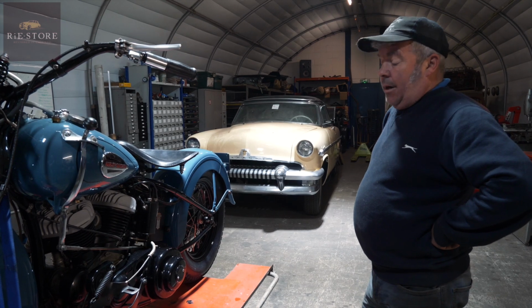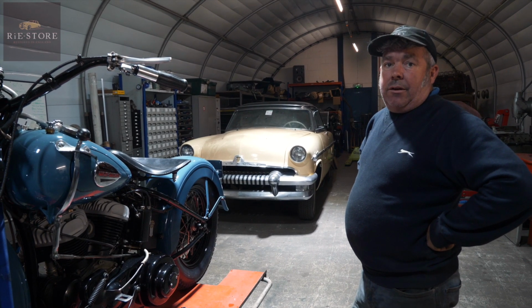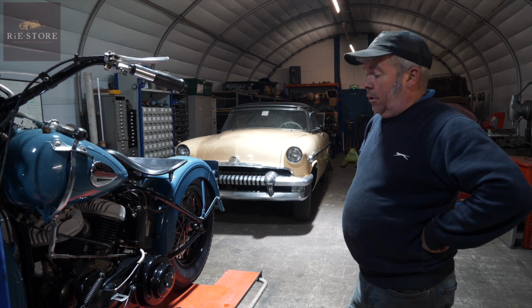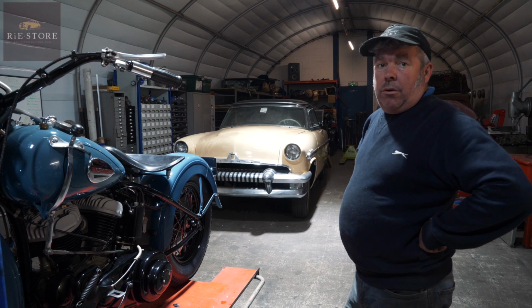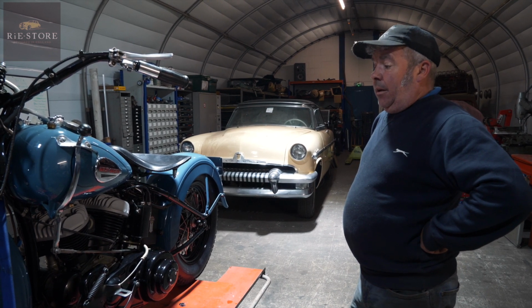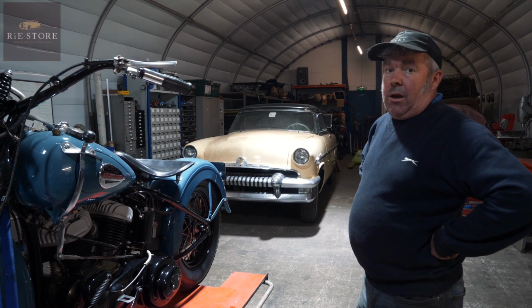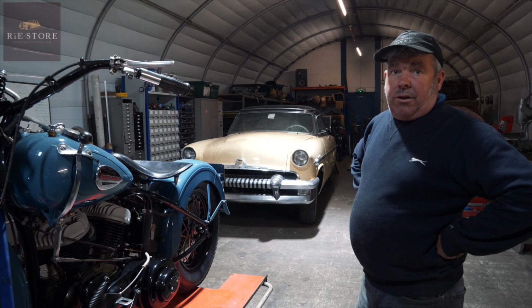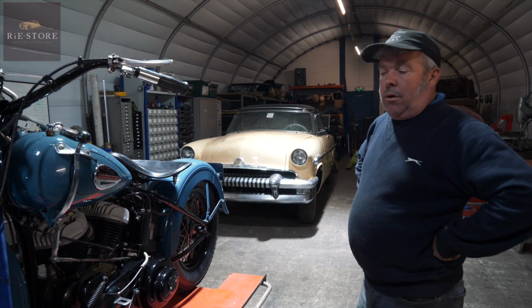Like I say, if it's a brand new oil pump in there, with all the ball bearings seated down nicely and as they should be, with all the right spring tensions, then it probably won't wet sump, but a lot of them do. So I think the ideal thing, if you can, realistically, is even if you lay something up, kick it over and start it once a week. That's your ideal scenario, because it'll keep the battery topped up, it'll keep the clean fuel.